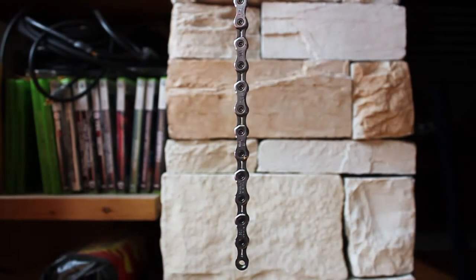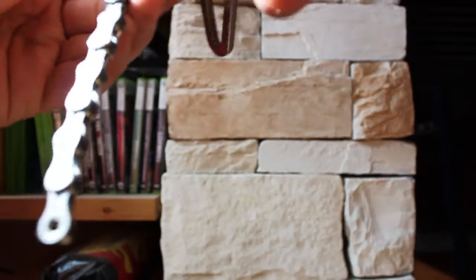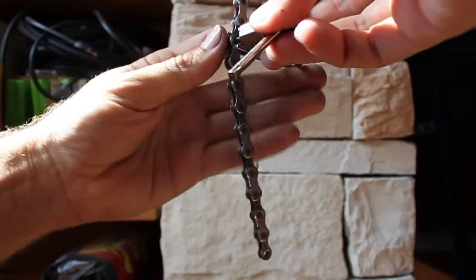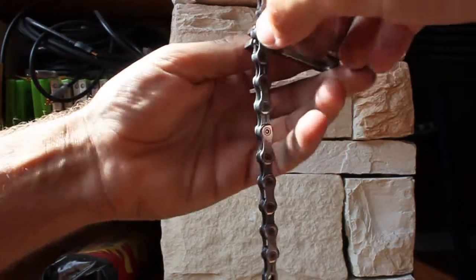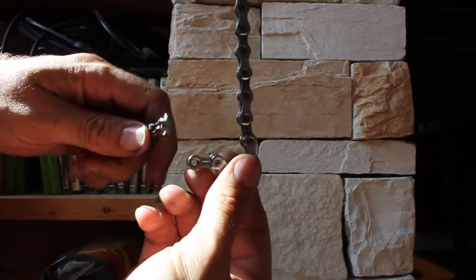Shimano's chains come in different lengths, namely 114, 116, or 118 links per chain. I usually get the 116 links one, but only need 111, so I have to remove 5. As most carpenters would say, measure twice, cut once. You don't have to push the pin completely out, just make it clear the inner link and twist it to break the chain.